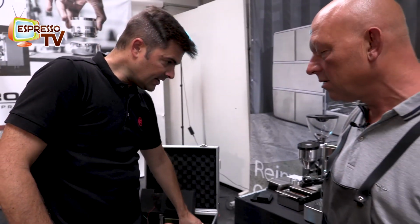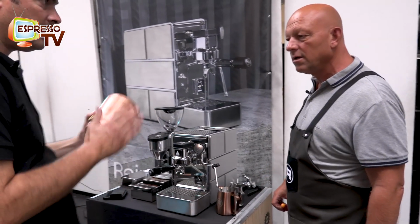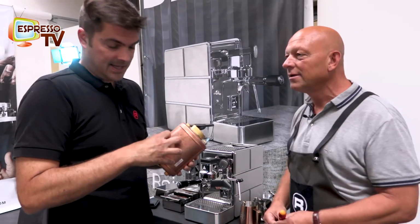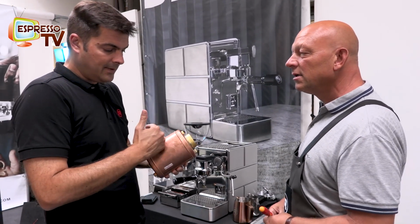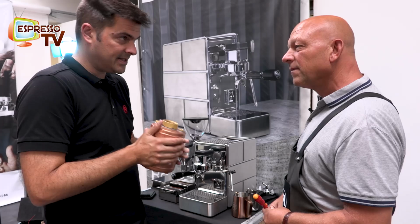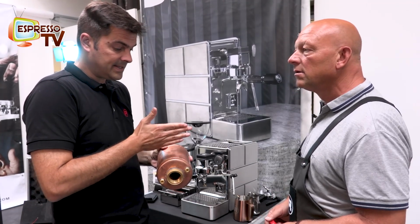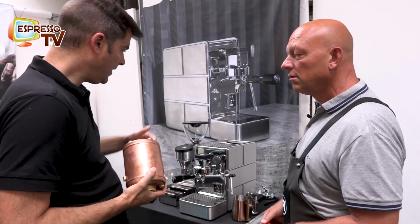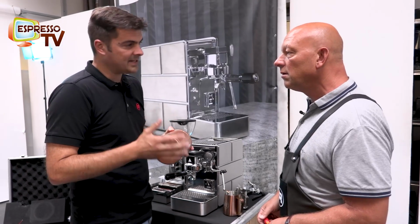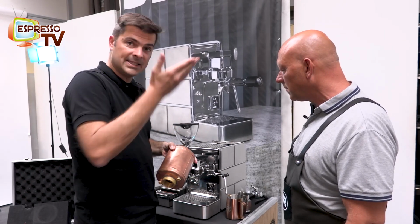Okay, cool. And the second point is the possibility to empty the main boiler. Why is this important? It's important because the water that stays inside is only for steam. And if it stays too long, the risk is that the pH can go a bit down, so bringing some acidity inside the water. And acidity means corrosion. Exactly. So it's better sometimes to empty as much as possible, so we have a method to do that manually, in order to empty the boiler till more or less the 80%. Okay. So you get some new water inside, and the pH gets back to normal.